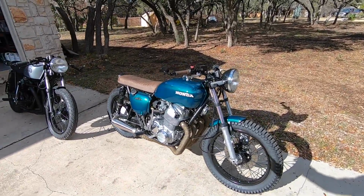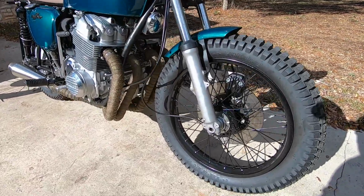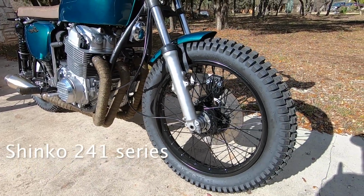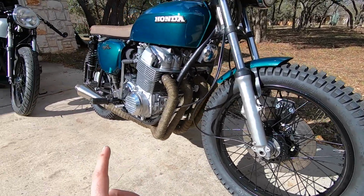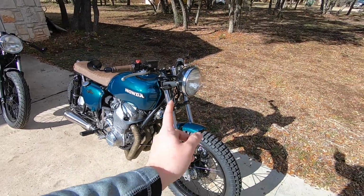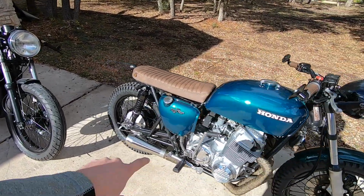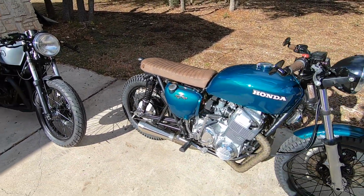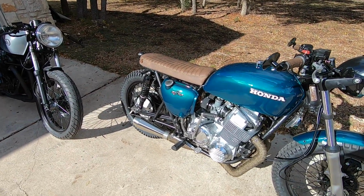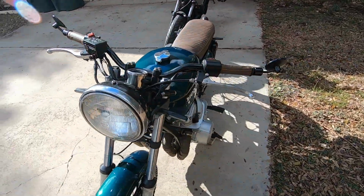So this got the full treatment as well. It's running the Shinko, I think these are K70s. I don't remember the model of these tires. I'll throw a link in the description below. 3.5, 19 in the front, 4.0, 18 in the rear. Chopped front fender, painted obviously to match the tank. 4-into-1 exhaust wrapped with a Cone Engineering 12-inch universal shorty muffler, something you guys are very familiar with. I run on a ton of my bikes. It is of course running pod filters, factory carbs, jetted to match.